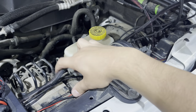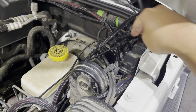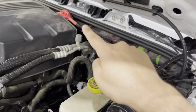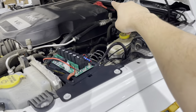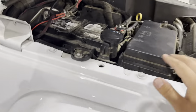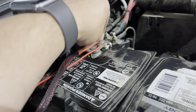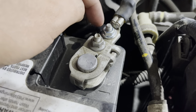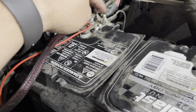For tucking the wires, I'm going to zip tie everything so it looks a little neater. To get the wires going to the battery, I took off the clip right here, popped it off, lifted both relays up — it was a lot easier than trying to tuck it underneath, especially with that box there. Then I zip tied it to the OEM harness. Make sure that's covered because that is a 12-volt bolt on top of there. I ran this one to a 12-volt source — to test it for now I just added a nut on top of the existing nut, but realistically you should take the nut off, put the post on, and then put it back.